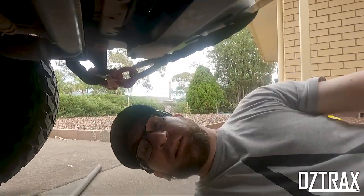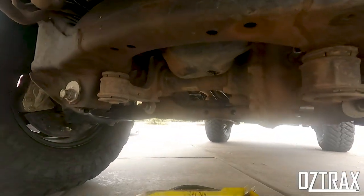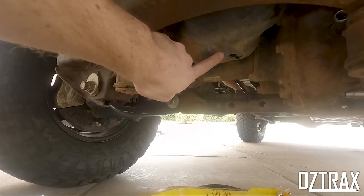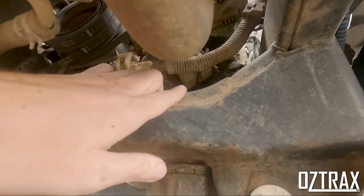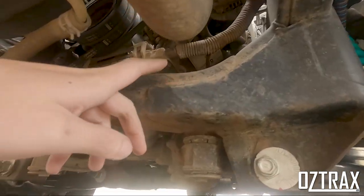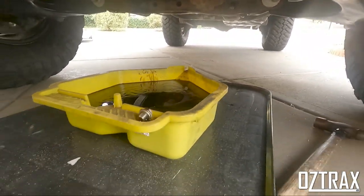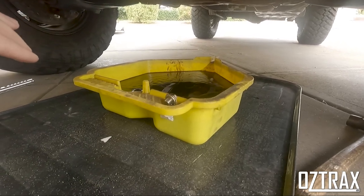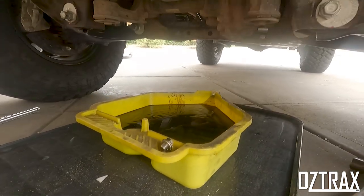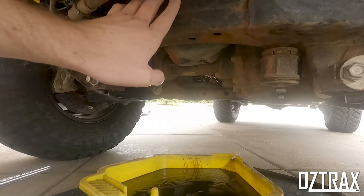I'm just going to jump into the car here. At the moment I've been doing my oil change. Your drain for your oil is here, your oil filter is hiding up there — best access is through the rubber panel on the side of the vehicle to get to the oil filter. And then you've got a big drain tray down here to catch any extra drops that may run down the chassis rail. That's pretty much your service one — it's a 14mm bolt for this one on your sump. I'm going to crack it open and let it drain.